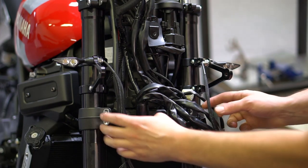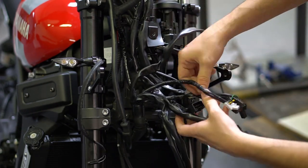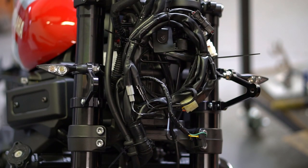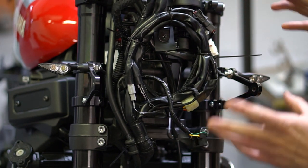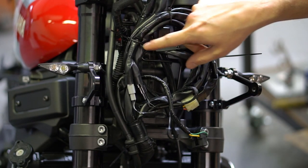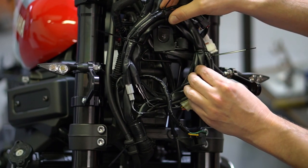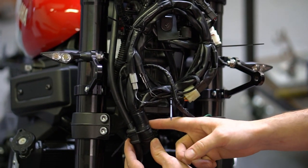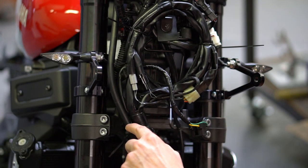Now do the wire routing — get the blinkers out of the way and connect everything together. The wiring assembly is naturally in a circular shape because it was housed in the bucket before, so take advantage of that. Make all the connections, run it into your circle, and find strategic points to zip tie everything together. Keep the mounting point clear with plenty of clearance. Also, zip tie the brake line to the wire harness — make sure you zip tie around the rubber spacer so you're not zip tying directly onto the brake line.